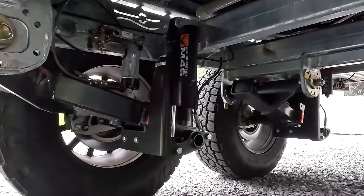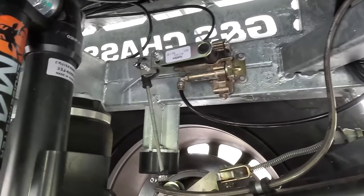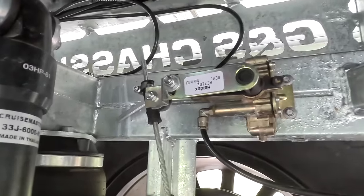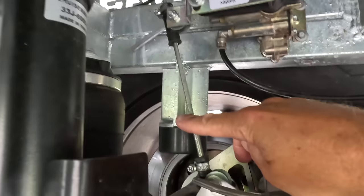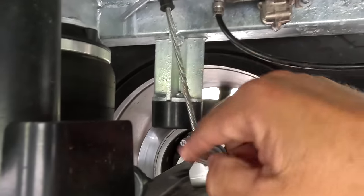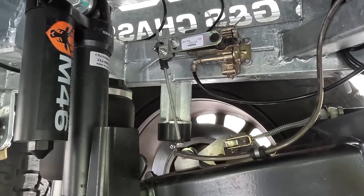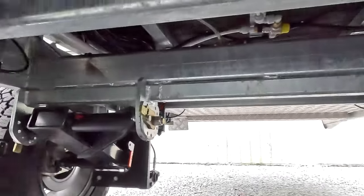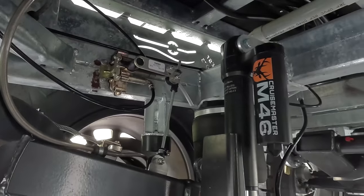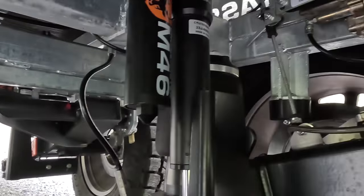All right. Oh, one thing I'll do, I'll come over here. So what I mean when I talk about auto leveling is it has this device here. You've got this auto leveling switch that's mounted to your chassis and a rod that comes down to your trailing arm. And now this tells it what position it's in and what it needs to be for your travel. So when you hit that auto, it sets it for you. It's one of them, and there's one of them on that side as well. Righto. It's neat, eh? God, it's nice gear.